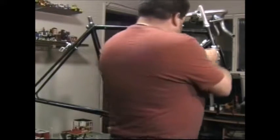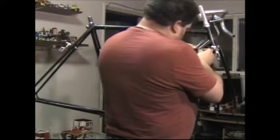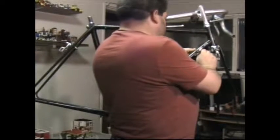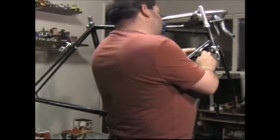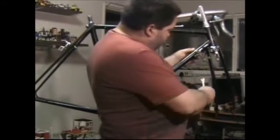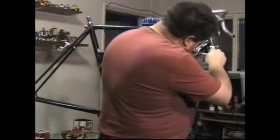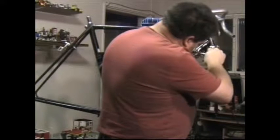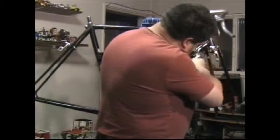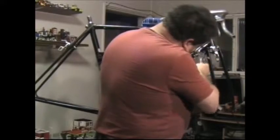Make sure you get it all lined up. I think that's 8mm. I'm trying to put this back in its original position so it hides the previous markings. For this I'm going to use an open-ended 8mm spanner and crank this up. Doesn't have to be super tight — just tight enough so the lever itself doesn't move on the frame.